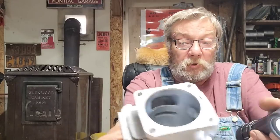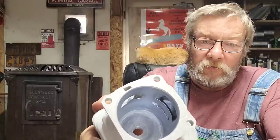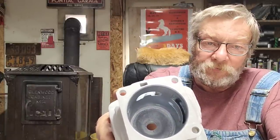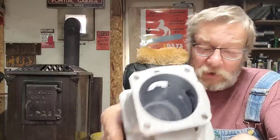I really think we need to change these cases just to build a better saw, because you're going to have nothing but trouble with those bar studs. But look at this — this is nice stuff. Nice nice nice cylinders, very very nice. See how narrow that squish band is? I like a fairly narrow squish band — it makes a better running saw. Some people think that's debatable, but I know what works and what doesn't.